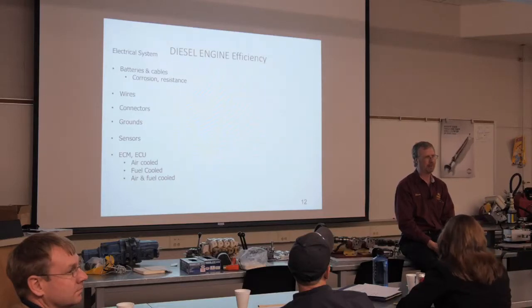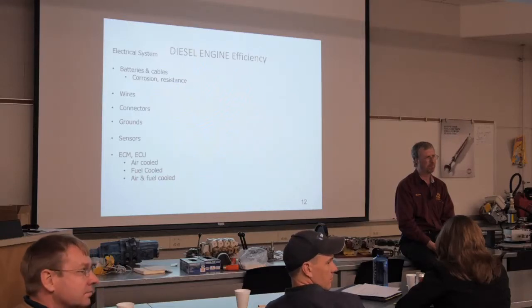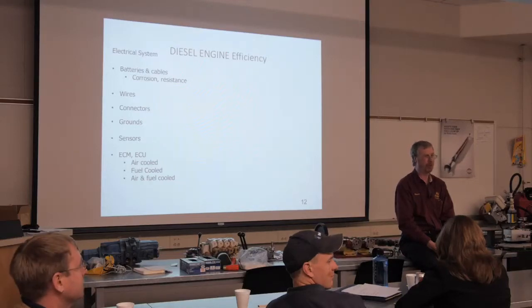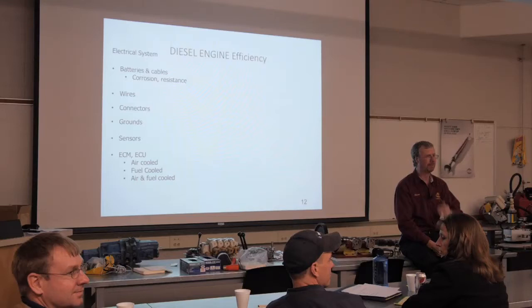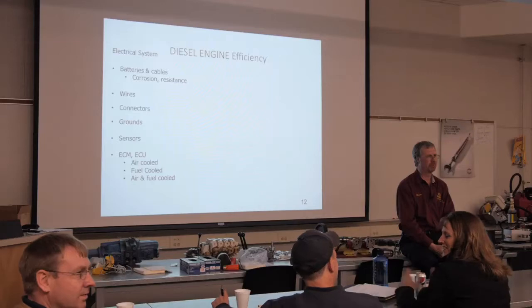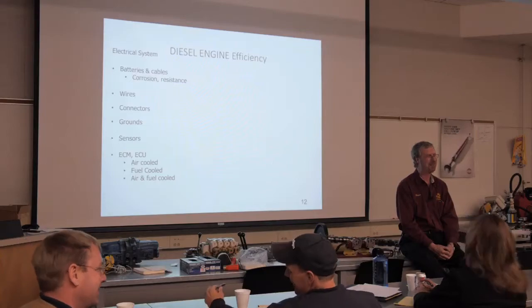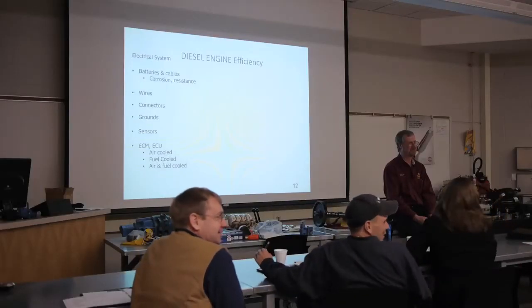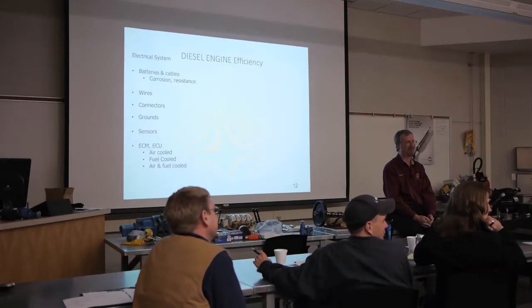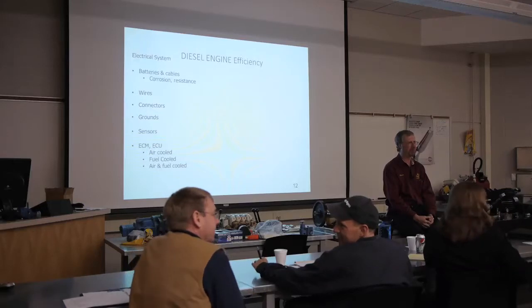Well, yeah. Now that I'm on this course, that makes sense to me. I had a vehicle that the dome light was the parasitic drain. So I pulled the light bulb out and never had any problem with it again. Right, took care of that circuit. That was my solution. Well, it was easier than trying to trace the wire through the headliner. Because it was an old junker vehicle. Now you did the right thing. That's good.